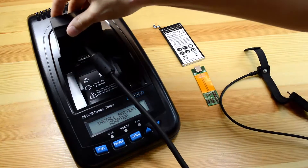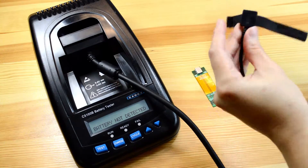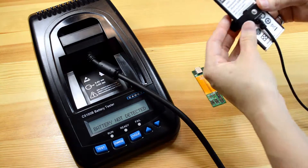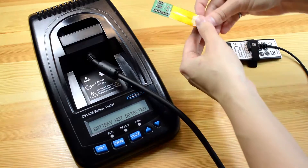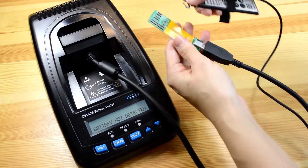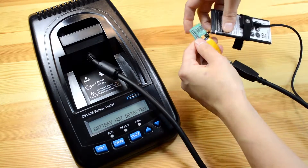Connecting our adapter, then we connect our temperature sensor to the battery, which connects with just this velcro here. And then connecting the flex strip to the USB here. And then connecting the battery to the flex strip — should be this one right here. It's connected.